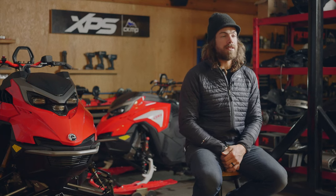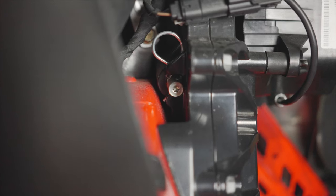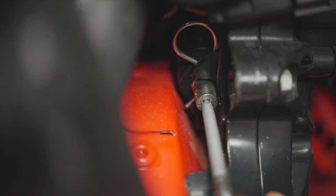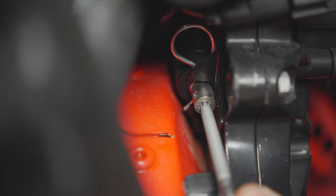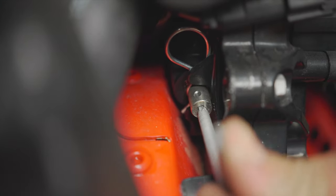If you need to adjust the chain tension on your snowmobile, grab your clutch tool and using the T25 side of it, very carefully by hand without leverage, start turning the set screw in on your chain case. Tighten the tension screw until you feel resistance, then back it off one turn. It's very important to not over-tighten, as you'll wear out the slide shoe.